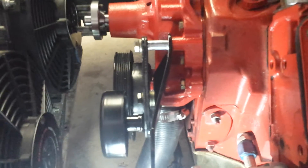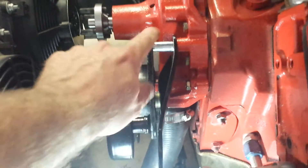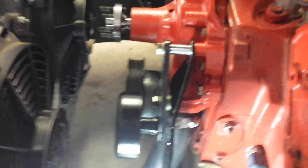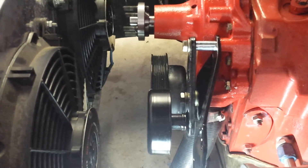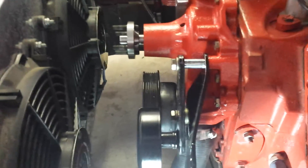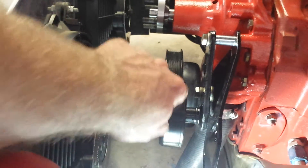What you see here — I've got three flat washers down here that gives me enough space to push this out, and then I've got a half-inch sleeve there, and as you can see it lines the pulleys up almost perfectly. I already test-fitted the belt before I changed the pump, and it rode right in the correct area on the idler.